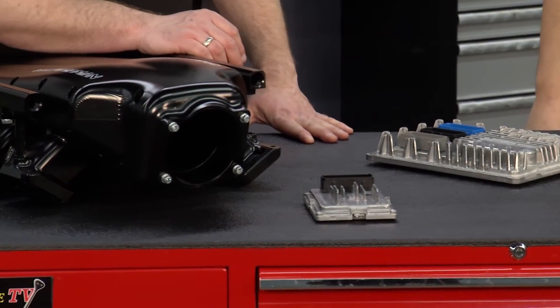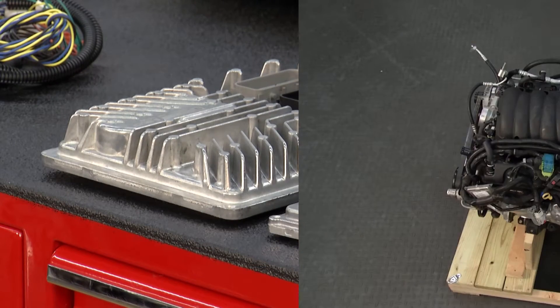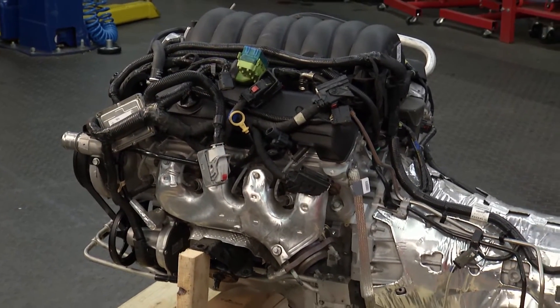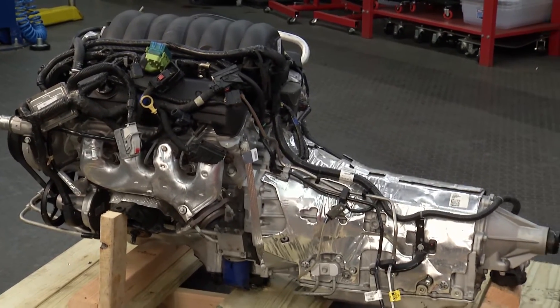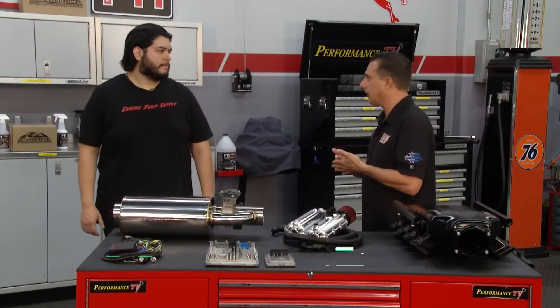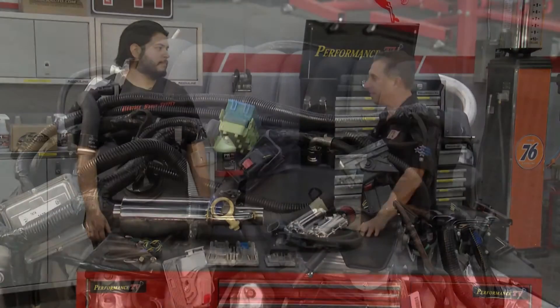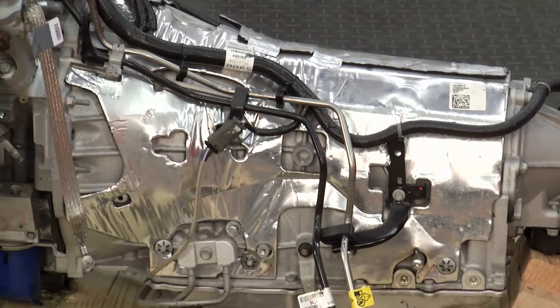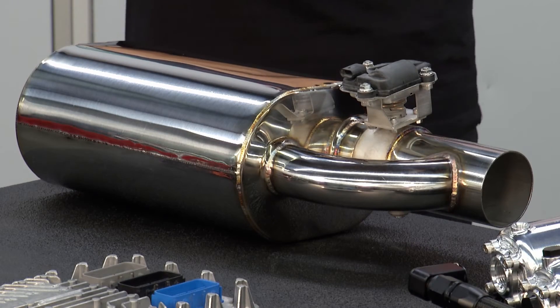It's not just about great components — earlier Joe Costello talked about complete engines. We've got an engine right here. What is this out of? This is out of a 2019 Escalade — it's an L86 6.2 backed by a 10-speed transmission. Let's say I've got a 1978 Pontiac Trans Am and I want to be able to drive it anywhere, do anything, and have great power. Can you make that fit? Absolutely. It's just engine mounts and cross members — once you have that, it's just a matter of putting it in like you took your original motor out. We also offer exhaust, bolt-on, plug and play, you're ready to go.